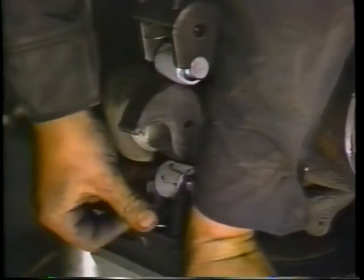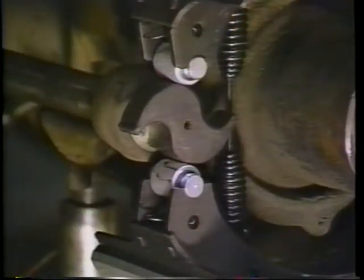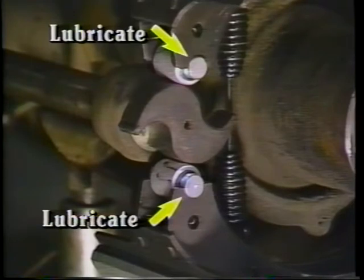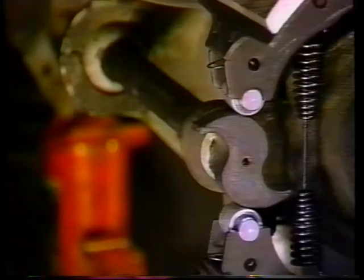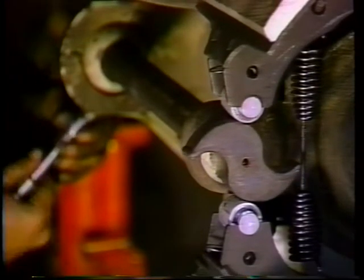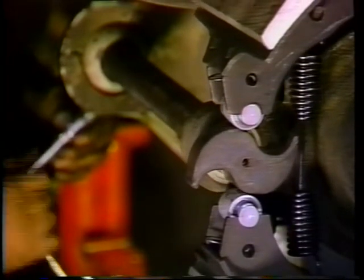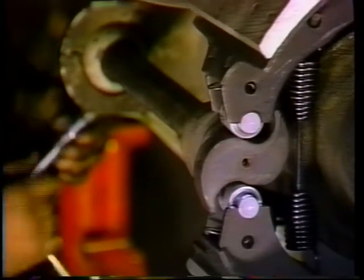Next, fit the brakes with new brake shoe rollers. Imperfections in rollers in this area cause unwanted noise. When installing the brake rollers, lubricate the area where the rollers contact the brake shoe, but never put grease on the roller surface that contacts the S-Cam head. Next, check for proper alignment to identify a bent spider. With shoe assembly completed, use the adjusting screw on the slack adjuster to rotate the camshaft to where the rollers are sitting on the lowest point on the cam head. This puts the brakes in their released position.